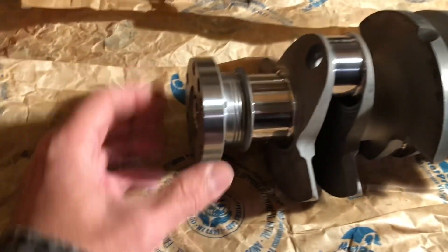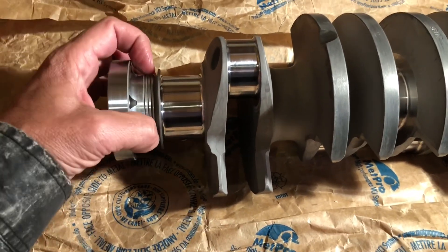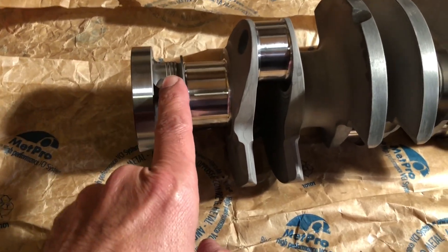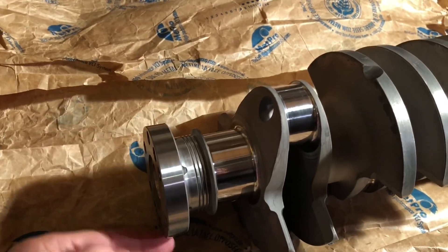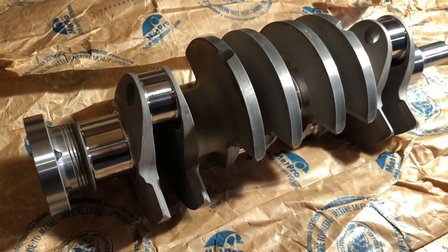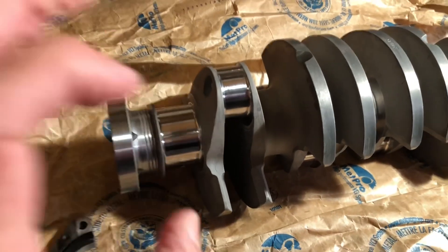The main thing is the diameter here that the seal ends up running on. In high performance engines, seldom are you going to see an actual seal be much larger than the main bearing - that's the strength of the crank. You don't want a huge seal surface. The speed at which this contacts and passes through the seal is far greater. If you look at the specifications of some of those seals in those very kits, they say things like maximum RPM 3150. An 8000 RPM race engine with a maximum RPM 3150 seal? This setup has no contact whatsoever - if you pay attention to setting it up, no leaks ever.